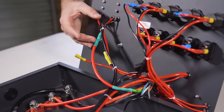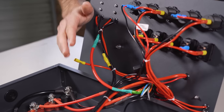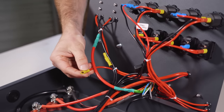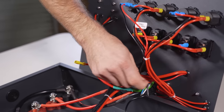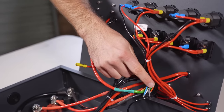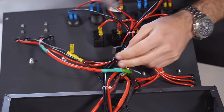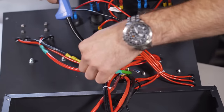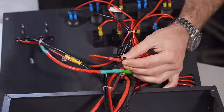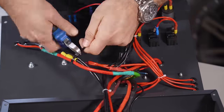As for the solar wire, we've connected it up to the quick connect plug which leaves a tail end — we're not going to let that go to waste. Because you have to connect up one of the wires depending on your battery type, you can use this as the input. In this vehicle we're using an AGM, so we're going to connect up the orange wire. If you're using lithium, you'd connect up the gray wire. I'm going to cut this cable tie, connect this to the orange wire, and cable tie it back up. Take your time, crimp everything together, and use heat shrink to protect it. While I'm at it, I'll clean up the rest of the wiring and terminate the white, gray, and yellow wires as they're not needed for this install, so we just need to keep them protected.